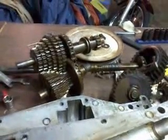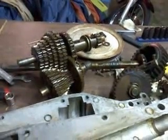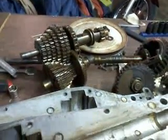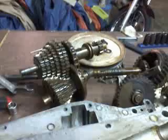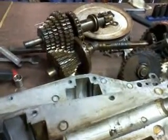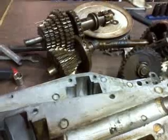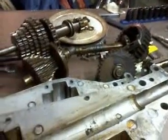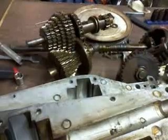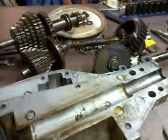I eventually took all the gears off and played with the keys a bit, wiped it down, put it back together, and it seems to shift. It's still a little interesting, but it shifts now. But I'm going to be tearing all those gears apart, cleaning them up thoroughly, along with the differential and axles, and re-greasing it all, so it'll be beautiful again. Well, that's if I decide to re-grease it.